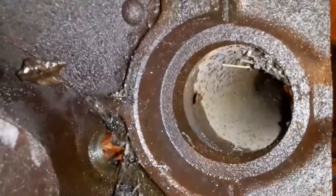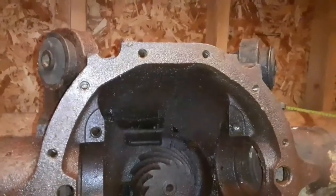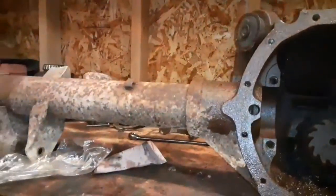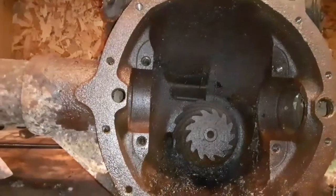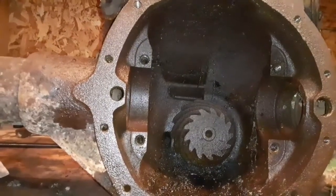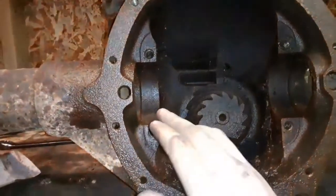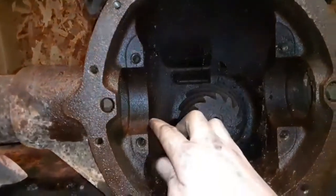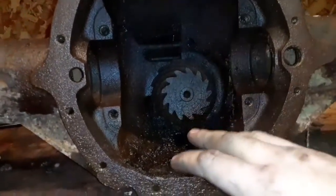I can make that work though. I've been stripping stuff out of it, like the fill plug, and it had half the control arms left on it — I cut them off. I still have to take the backing plate off and the pinion out, then I can take it down and wash it. I'd like to soak it in something like oven cleaner to get some of the caked-on dirt out. You can see there's a difference in the rust color — there's a mud line.